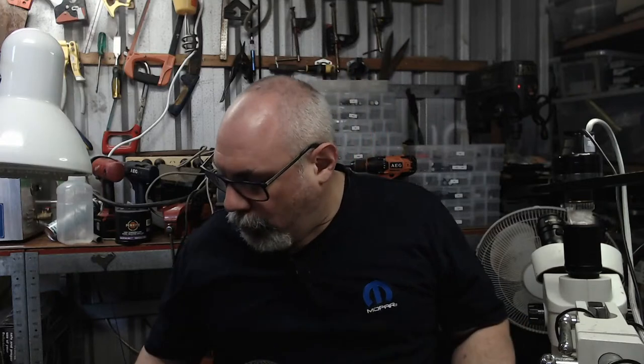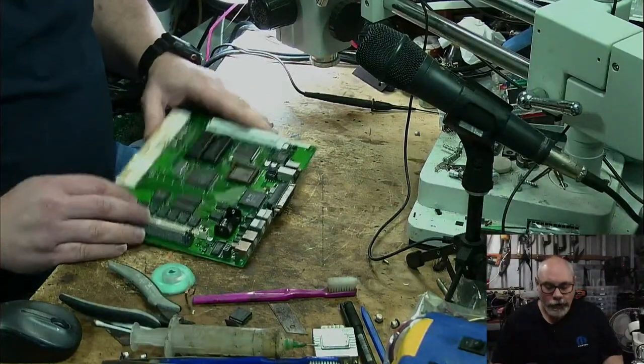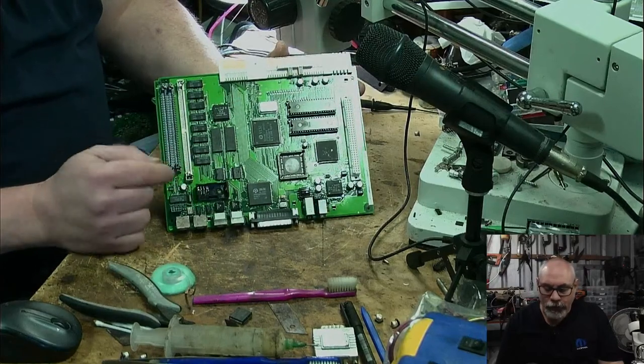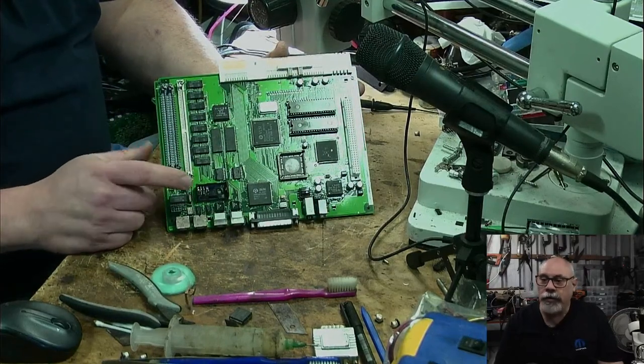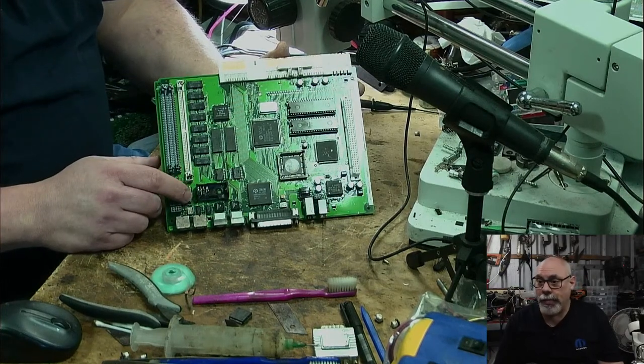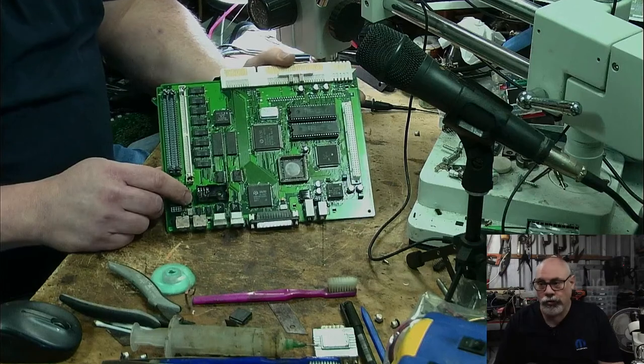I just wanted to, while I'm here, oh, my quick keys. This is a Color Classic board. This is one sent to me before. This is one where a person recapped it themselves. It has some battery damage. It's not very nice. This one starts up, but I shouldn't say it starts up. We get a power light, but it doesn't boot, it doesn't chime.